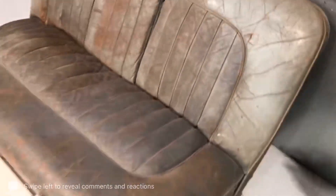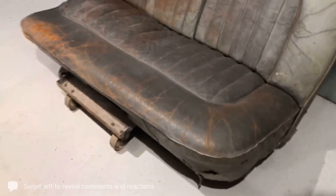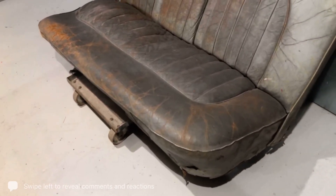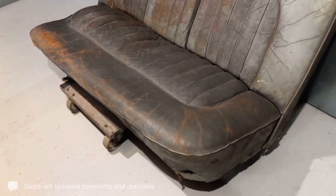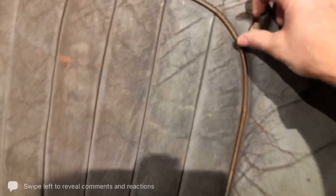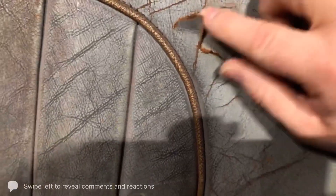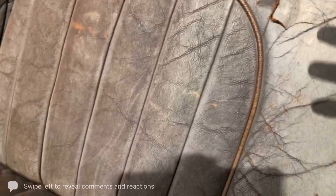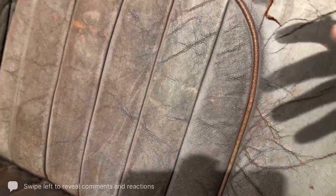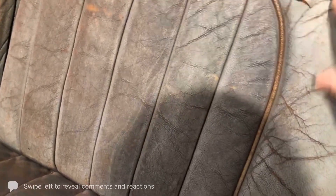So how can I tell this leather is a different leather to this one here — and how can you tell when you're looking at a classic car? All classic cars which are Connolly leather — the majority prior to 1980 were Connolly leather. How can you tell? Well, on the back of the leather, as you can clearly see, it is brown. This is a veg tanned leather, dyed with natural vegetable extracts like bark or plant material, tannings and such. And then it's painted on the surface.